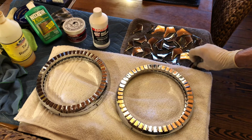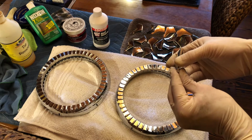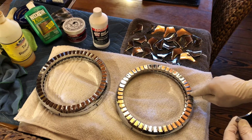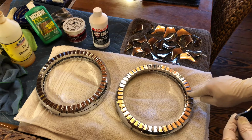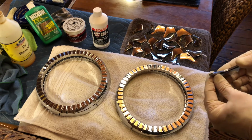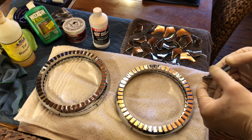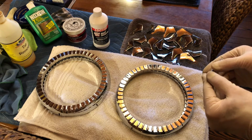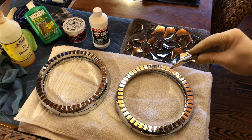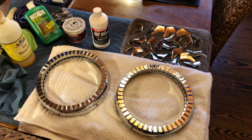One of the best things is these ultra fine ribs that are on the appearance surfaces of these fins that align with these grooves. Very difficult to clean any other way but chemically, because you really can't get in there. The grooves are so fine, you really can't get any rag or Noxon to actually get it clean. So the chemical process works just spectacularly on these parts with no damage.